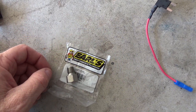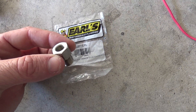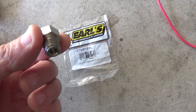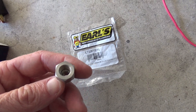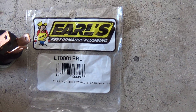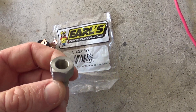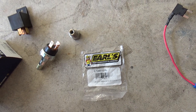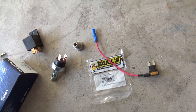This is a cool part here - it can be used for not just this but anything. It's kind of an obscure thing. What this does is when you have your vacuum pump delete, if you're doing a swap or you remove the pump, you can remove that top plug and replace it with this. It has an eighth-inch MPT threaded adapter - that's Earl's part LT0001ERL. Then we have a Bussman add-a-circuit with a five-amp fuse for the whole deal.